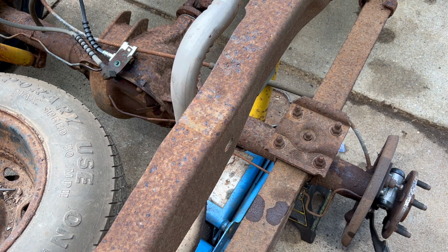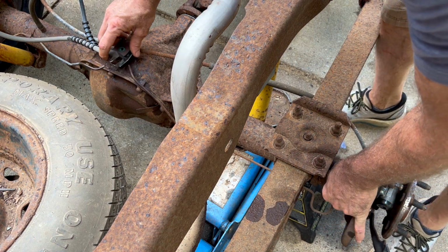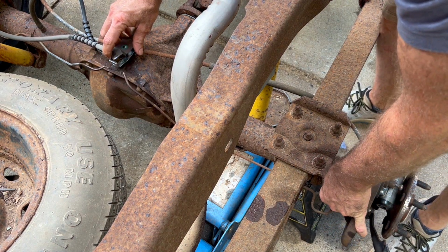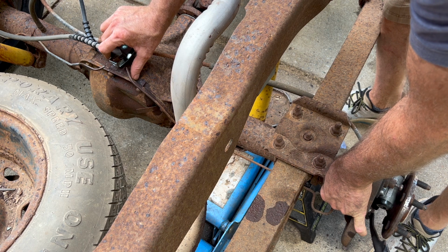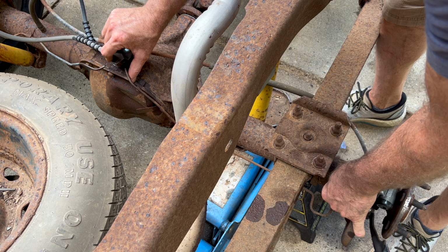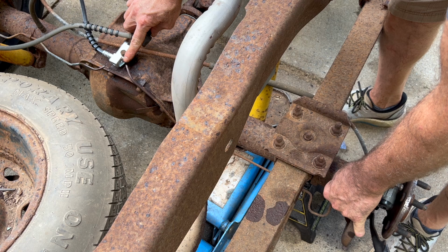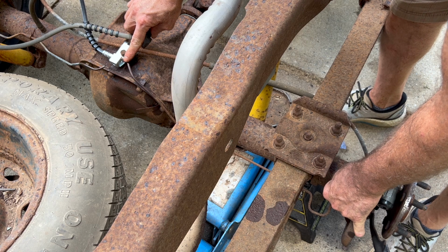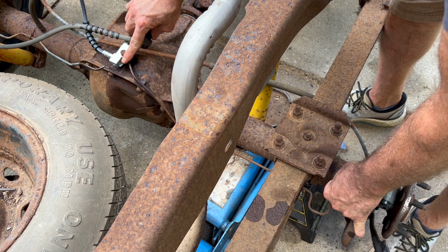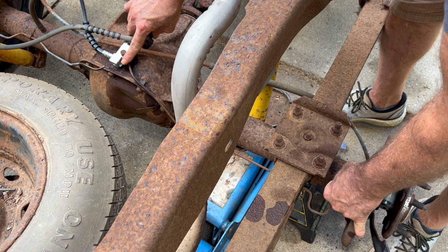Look at how the old brake line would have come in. This would have been here. You can see where it would have been coming in at a diagonal. And obviously it's short because it's been cut, but now if you look, I've actually got to make it come in straight. So it may have a bend on the end of it, or it may just stay straight and have a slight bend to line it up.